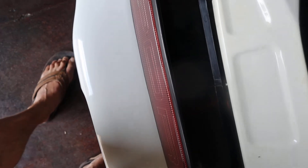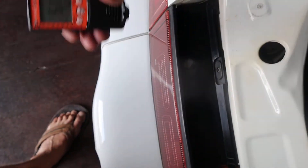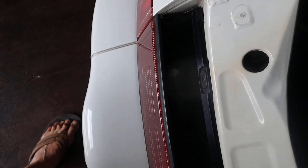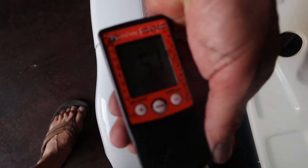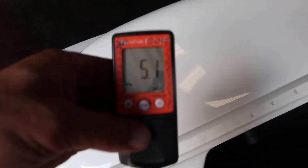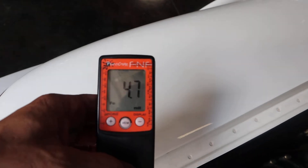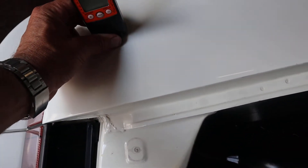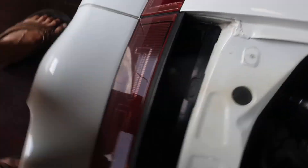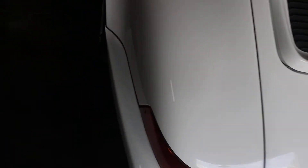In the corner there's probably some paint here — reading 5.1. Anything under 4.5 would be factory. So 4.7, really close. 5.4. I'll just go around that. 4.5 and under is factory.